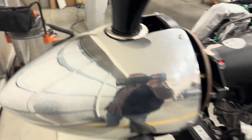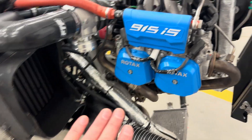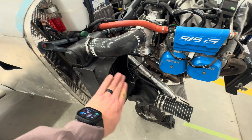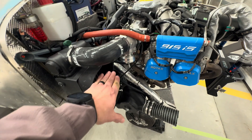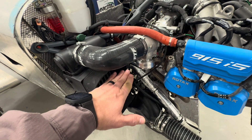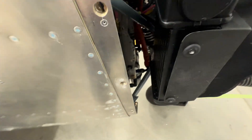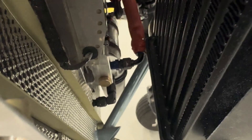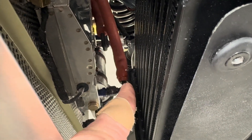One of the things I have to do is lower the intercooler. When the scoop comes in here — let me zoom back out — it's about an inch too high. So I've got to reconfigure this to lower it down just an inch. I also need to see if I can come out just a little bit, because it's really close to the fuel manifold where I have a hose coming out. It's not touching, but I'm worried that with vibration it might hit that, and I don't want it to hit that ever. So I'm going to see if I can come down and then out just a little bit.